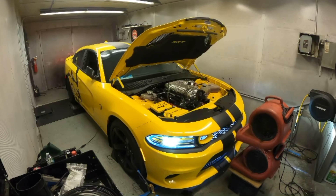After the run, the fuel pressure went to about 3.5 PSI drop — and when I shifted the second time it was probably about 4 PSI. It didn't drop — the lowest it dropped was 3.5 between shifts. It went up on throttle. The speedos are still way off from each other but they're running equal to each other now, which is a plus. We're getting a mile or two closer to accurate.